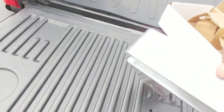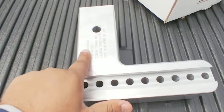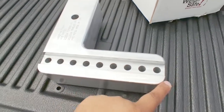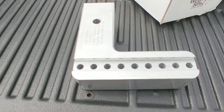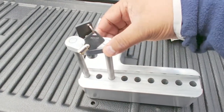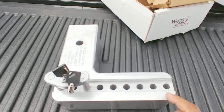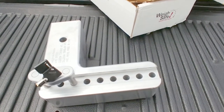This part is heavy — pardon the camera, one-handed. This is the part that actually fits into your hitch. This is a three-inch receiver portion, so it goes into my three-inch receiver. This is the adjustable piece. What I purchased here is a six-inch drop, and every hole is about an inch apart, which gives you your six-inch drop. It spans three pins when you hook it up — one, two, three, four, five, six — that's your six-inch drop or rise depending on which way you put this on. Let's hook this sucker up.